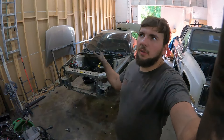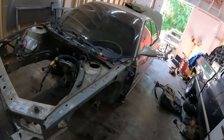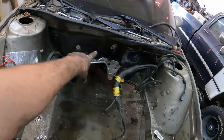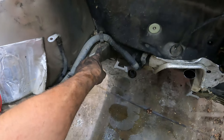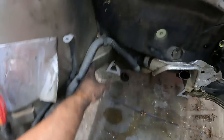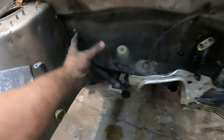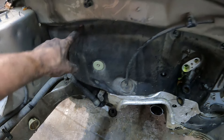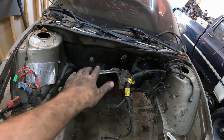Now that it's mostly been reduced to a pile of parts, we can look at what we're going to have to do. I still have to take apart the interior and get all the lines that run to the back out, get this electrical stuff off, and clean all this up. But up here, just like the Grand Prix, these little turn-in areas have to be removed — it has to be flat versus kicking out. That's on both sides. And then this bump in the firewall, where the AC box kind of bumps into, that also has to be removed. There's no way to fit something up here the way we need to with that there.